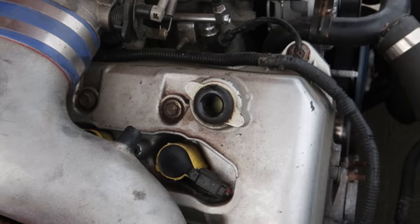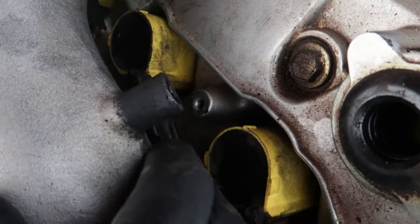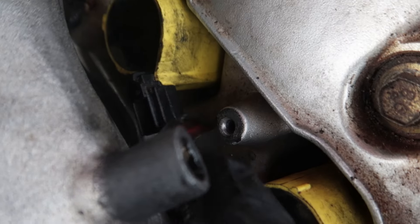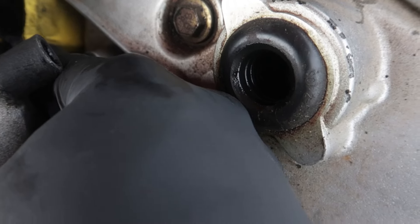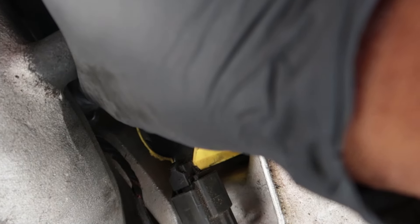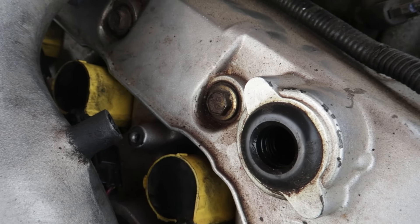The driver's side is good, now we gotta check the passenger side. Do the same thing - it might be a little tight because of the cold air intake, but you'll be able to get it. If you can't, you can pull the intake out to give you more room - just be careful because oil can shoot out. Go ahead and unplug your coils one by one. Cylinder number two - when you unplug it nothing happens, the idle is still the same. I plug it back up and the idle is still the same. That tells me it's cylinder number two that's bad.